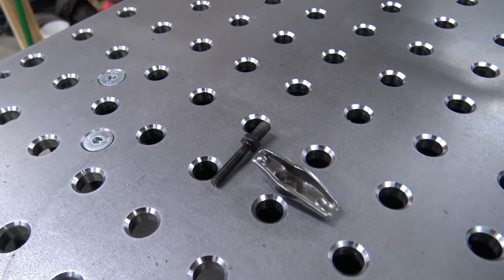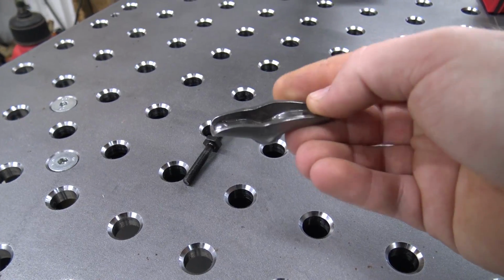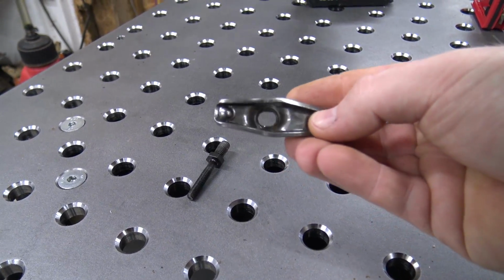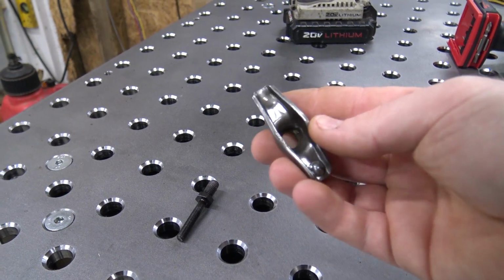Now if you go to ratio rockers, of course you're going to get more power because you're going to get more lift out of your cam in your valve train. So I got the 3 different sets of rockers laid out on the table, and we're going to look at them and show you the difference. Okay, so these are the stock style non-Hemi rockers. Now the Shredder does come with 1.2 ratio rockers. These are 1.2 ratios, and they're just in the stock style.